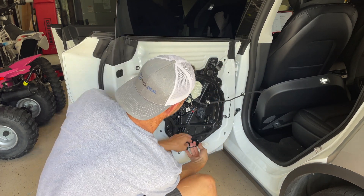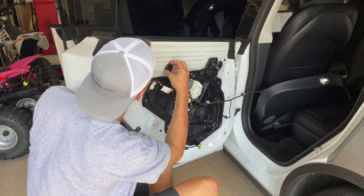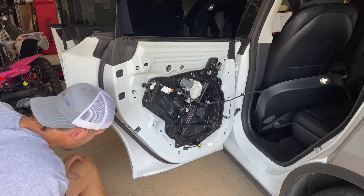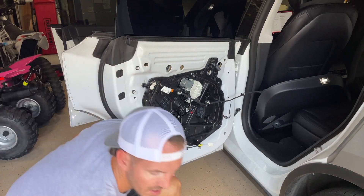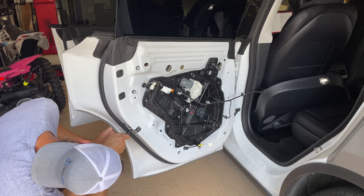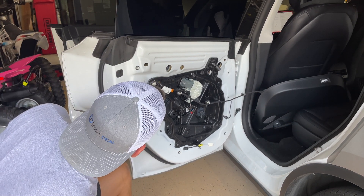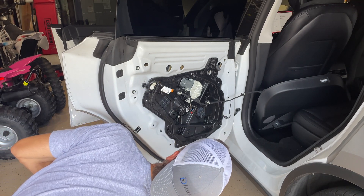I just followed the clip around and removed everything else. That's the emergency door pull. Next thing we're doing is removing the four rubber plugs — there are two big ones and two small ones. What I'm doing is activating the door so that it thinks it's shut, and this will roll the window down, had you left the wire harness plugged in.